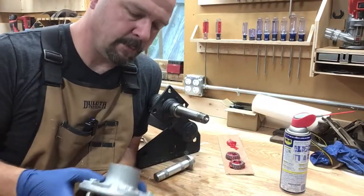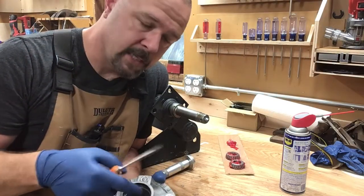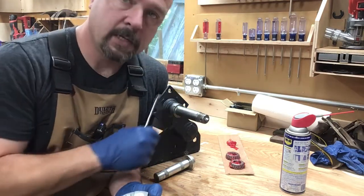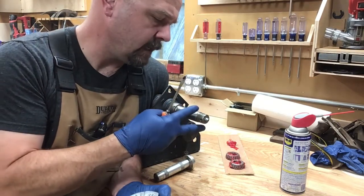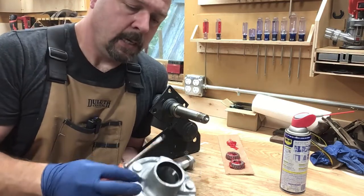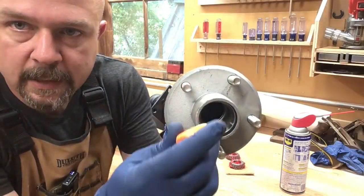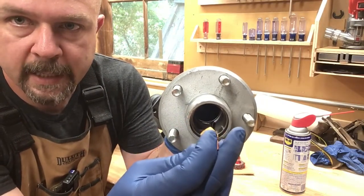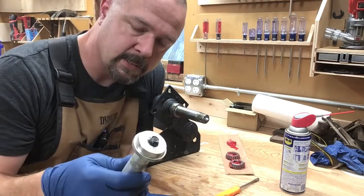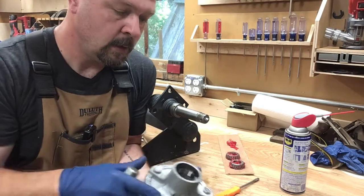So I have my bearings packed. I'll show you how to assemble it. But first, I want to talk about what we would be doing if this wasn't a brand new setup. If this was a used setup where bearings wear out or the thing got overheated and you wanted to replace the bearings and the races — it's very important when replacing to replace both the bearings and the races at the same time. This is not a tapered axle, this is straight, so the bearings are the same on either side. On larger trailers they'll be tapered, so they'll have a larger bearing in the back and a smaller bearing in the front. The races come pre-installed. If I was going to take these races out, I would take a screwdriver or a punch — there's just the tiniest little lip right here — get that in there and pound on it, move around and pound on it until the whole thing comes out. To reinstall a new one, you need a bearing race and seal driver set. You can see this is tapered just like the race. You would put it in square, hammer it home, make sure it's driven down nice and flush and snug, and then install the bearing.